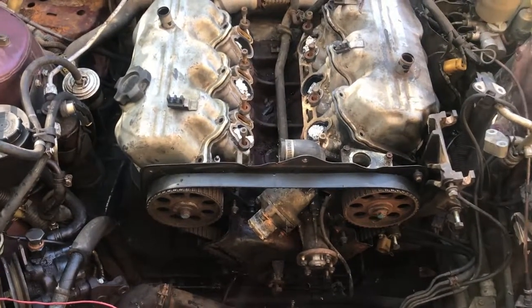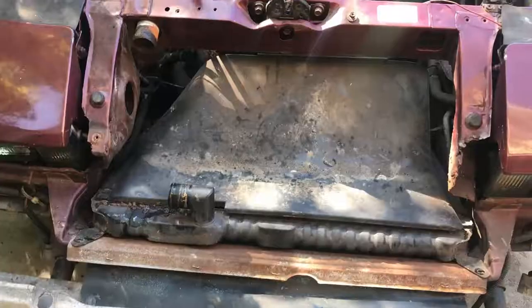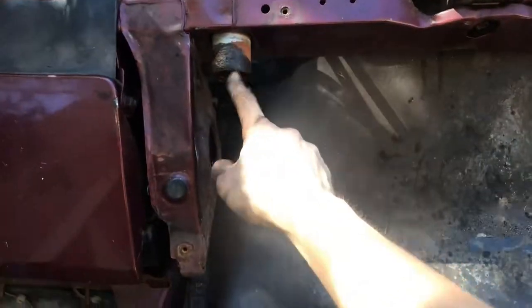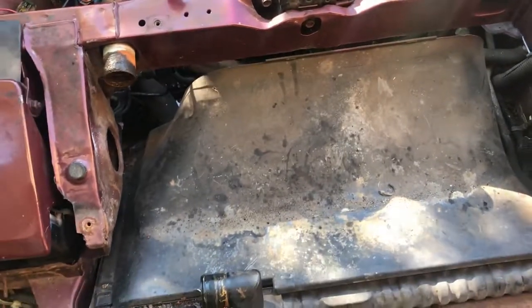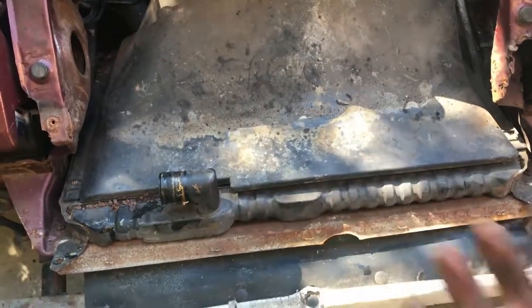Lastly, I'll have to drop the exhaust, and then I'll be able to pull the engine and transmission out of the car. I removed the coolant crossover tube that used to be here — it was just two hose clamps, so that part is now free. Now the radiator is able to be moved. I'll try to slide the whole radiator assembly out of the front of the car.